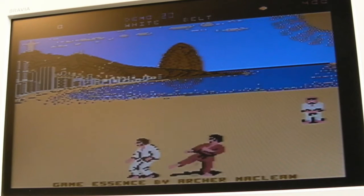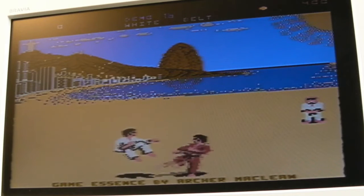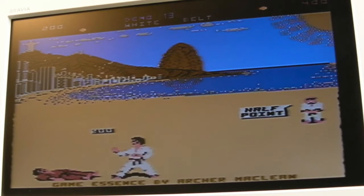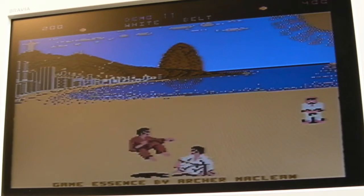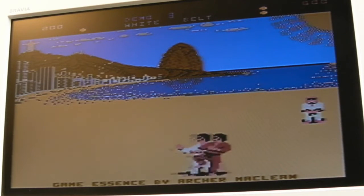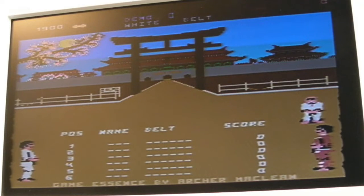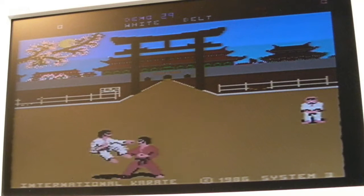Not that. Above that, around the modulator again. A little bit of glitching coming, look. Yeah, heating that transistor around there, we get some glitching, but obviously that's not affecting the colour. It's just some lines coming out like this. So I'm reluctant to think that's the issue, but then again, it's so sensitive to temperature out there. There's something not quite right. It's surprising how sensitive that area is to those temperature variations.